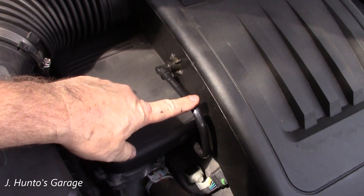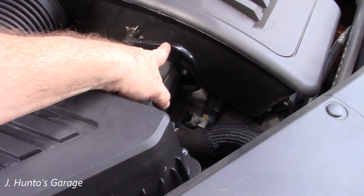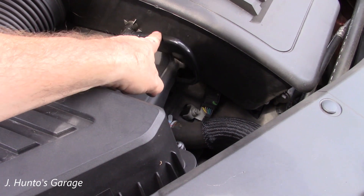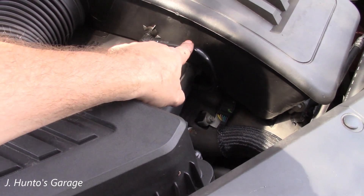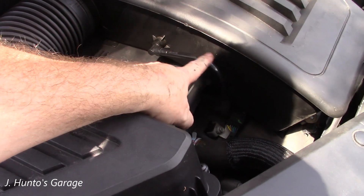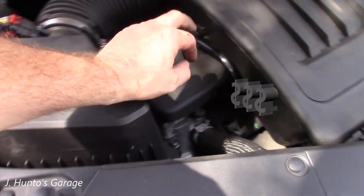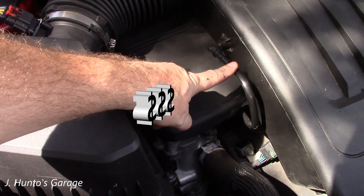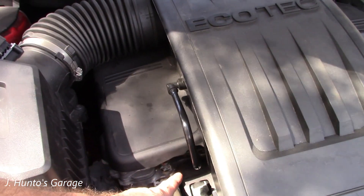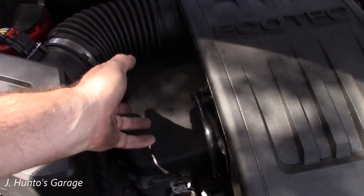You want to make sure this PCV pipe is cleaned out periodically — because this pipe goes up at an incline and then drains down, it tends to freeze up in winter environments. If it gets plugged up, you're going to lose your rear main seal and front main seal — it's going to be ugly. Always make sure this is clear; it's just a matter of taking it off with the valve cover, spraying some cleaner through it, and sticking it back on.